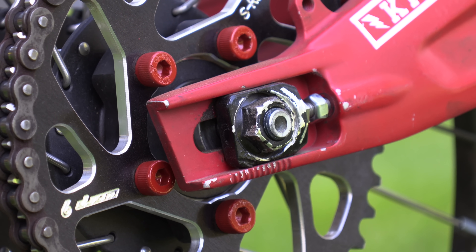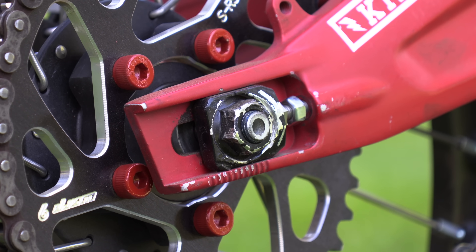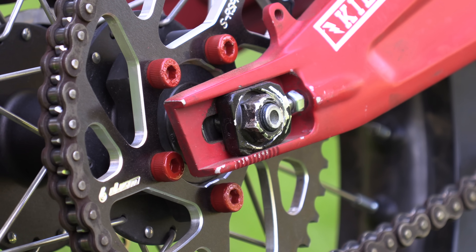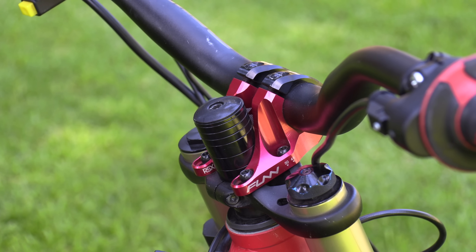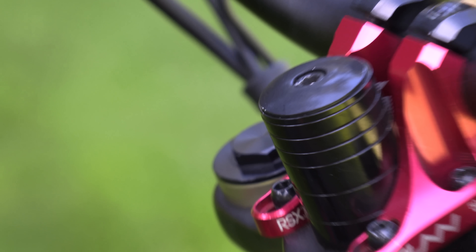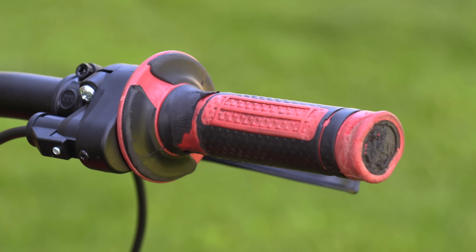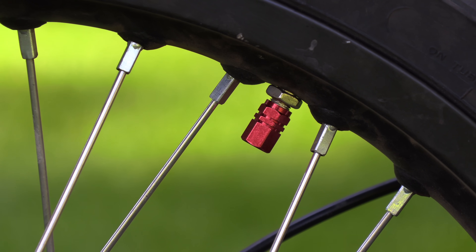Sometimes it's the little things. I upgraded the nut holding the rear axle — it's a 10-millimeter axle; the stock one is 9 millimeters and made of more robust steel, picked up from a hardware shop. After taking the wheel on and off a bunch of times, that nut gets balled and you can't remove it, so I replaced it proactively. I also got a direct stem mount — really nice for keeping handlebars straight when you tip the bike. Added some spacers to fill up the stem, threw on some Domino grips for the aesthetic, and finished with little red valve caps.